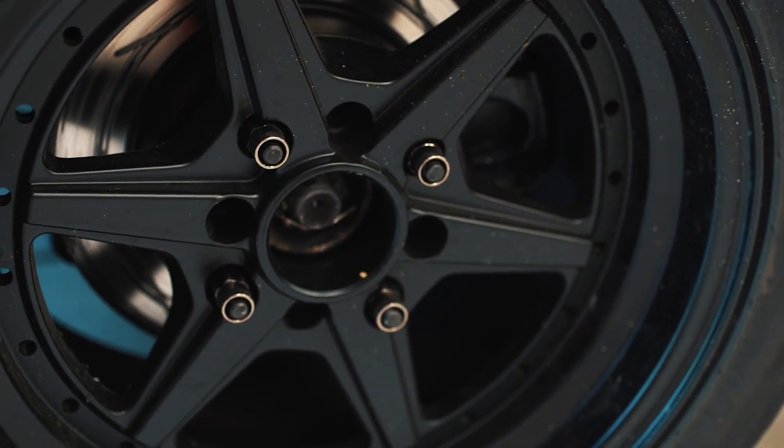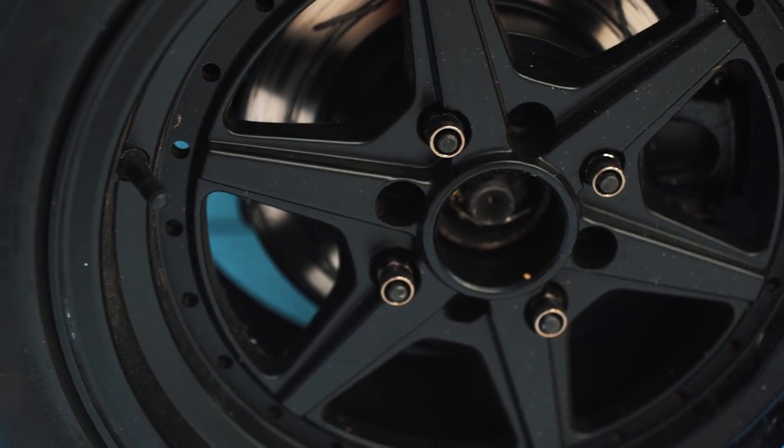The best way to get the wheel fitment is ordering the right size wheel for your setup, but everything can vary from the price of the wheel. We have custom wheels that are available when you need them, but mostly it has to do with price and what's available. Most people get something that's close, and depending on what tires they end up running, they may need to move their wheel in or out 5, 10, maybe even 20 millimeters to fit their desired fitment. So today we're going to talk about what studs are available, what spacers are available, and which one's going to be best for you — whether we use slip-on ones or bolt-on ones — and what I've come up with over the years of trying to get stuff to work.